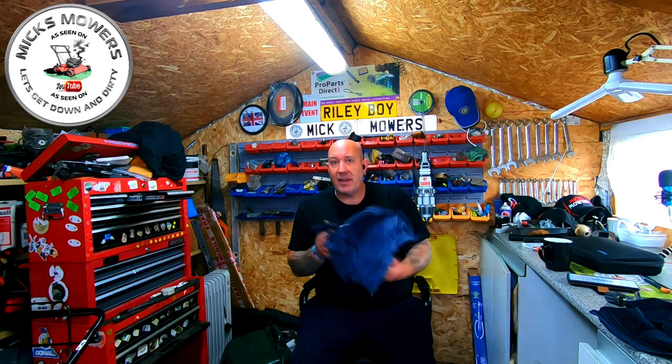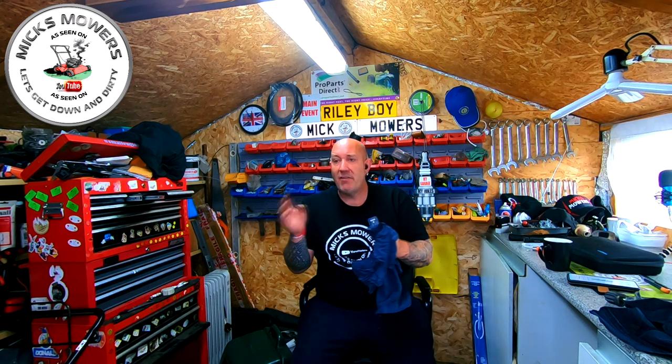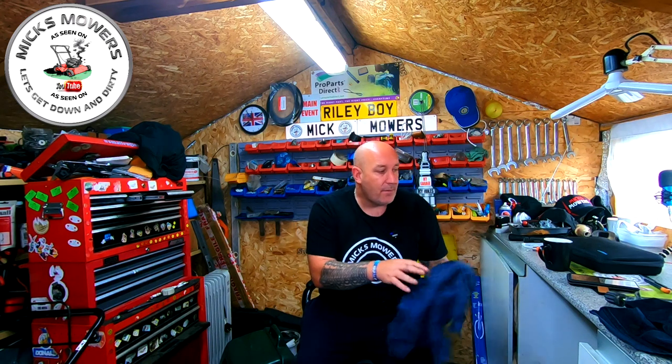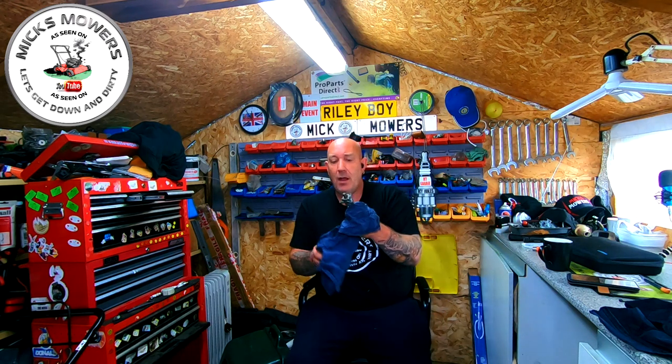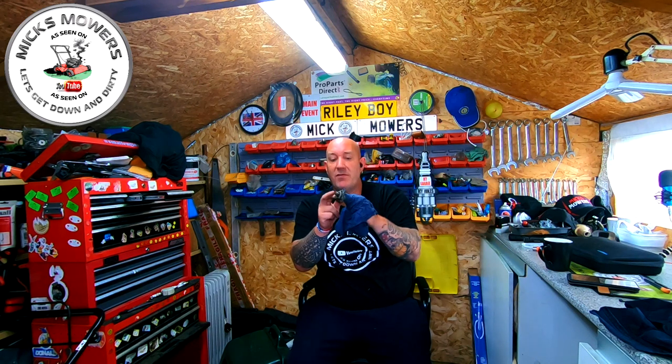In my opinion, the ring gear doesn't need doing. Unless you want to just take the ring gear off, you'll see that in one of my other videos. Take the ring gear off, get a little Stanley knife or something, just scrape all the grease and gunk out of it, clean it with petrol, put it back. They're aluminium, so generally they don't wear out, okay? But that upgrade, thank you very much, Chislehurst Motors, for putting me onto that. That's what YouTube's all about. They put me onto it and said that generally that fixes it. So it's actually the bushing and the movement within this aluminium plate.